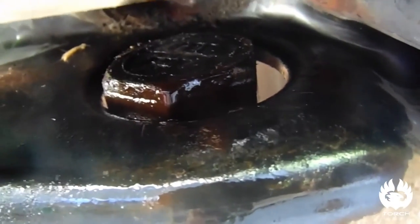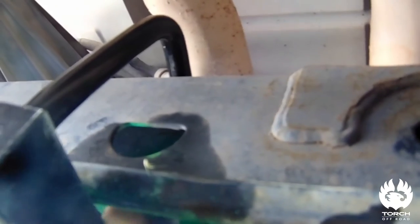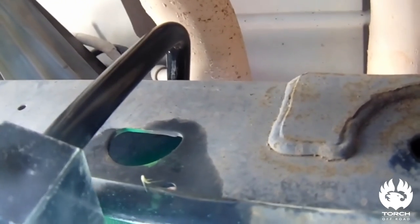It's tough being underneath this thing — not much room to film. Here we go: right here is the hex for the torsion bar, and your key goes right in here. That hex difference is what made it lift. It just slides right into it. Over here is where the set bolt goes — tighten it back up, put the set bolt in through here, which sets that clamp right up in here. That's what tightens it and sets your ride height.